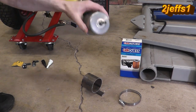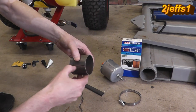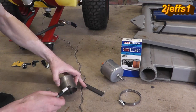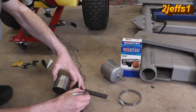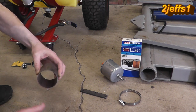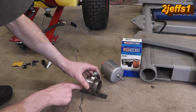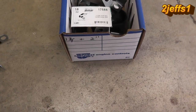To mount your fuel filter, here's a neat little tip: get a chunk of exhaust tubing and cut it in half — there's your seat. If you've got too small a tube, spread it open a little more. Then get a flat plate like this and take your cut-off wheel or grinder, cut maybe about halfway through it, drill a couple holes on the end. Then take your tube and your hose clamp — you've now got half a collar — so your hose clamp will fit through there. Weld your tube onto the plate and now you have a way to mount your fuel filter.